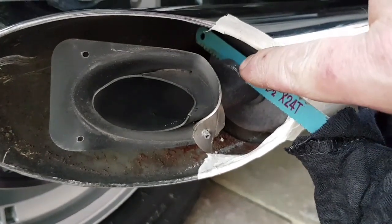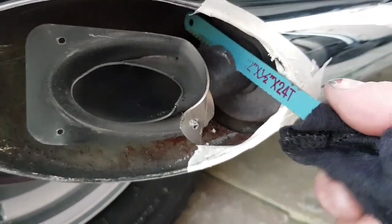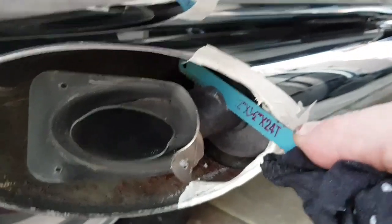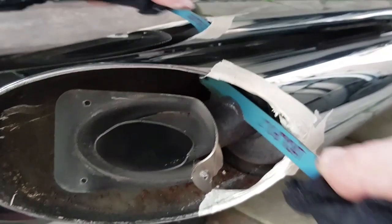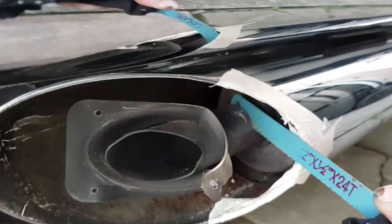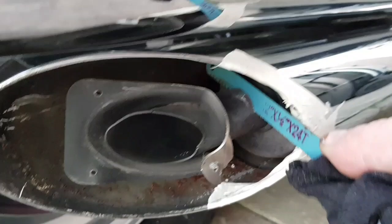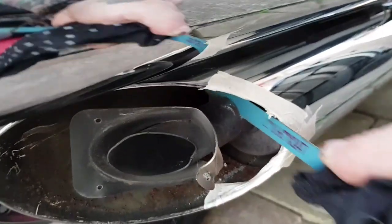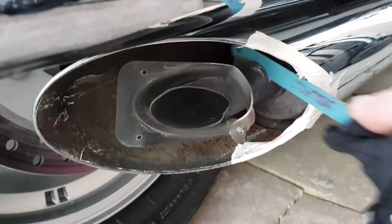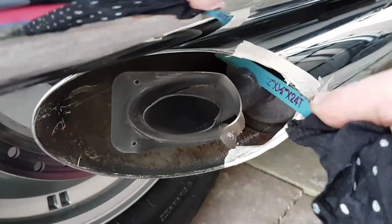That's what I mean — you've just got to get a hacksaw in there. I'm just using a blade with a rag. I'm finding it a lot easier to cut on the pull stroke, so I've got the blade so that as I pull it back it's doing the cutting — not forward but backwards. I find that helps a lot. It's just a case that you've got to keep wiggling away until we've got this trimmed off and we can go to the next stage.